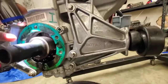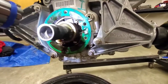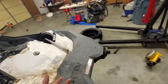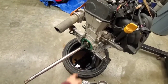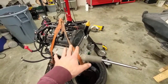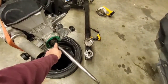I don't see why you can't take a Dremel to the exterior of it and cut a relief cut in it, then take a pry bar and hit it. But I don't want to ruin the crank and not know if it's fixable. I have a problem with the coupler, which everyone has a problem with the coupler. I've seen a lot of jackleg fixes where they take this output shaft, stick it in, and then weld it — or shove JB Weld in there. That will not work, because you have rubber motor mounts. As you jump it and turn, the ski and the motor itself is going to move a little. When the motor moves, this thing has to be able to flex a little bit. When that can't happen, you end up breaking your collar off the crankshaft.